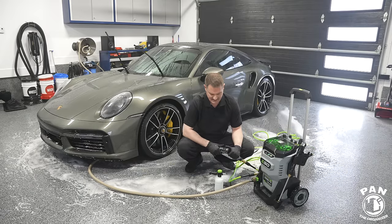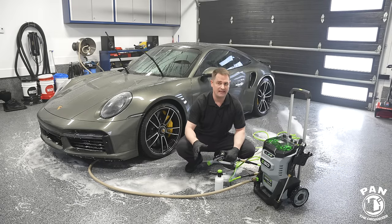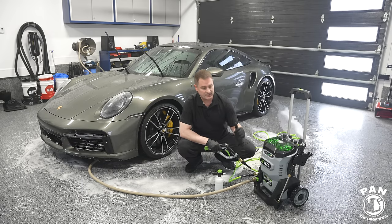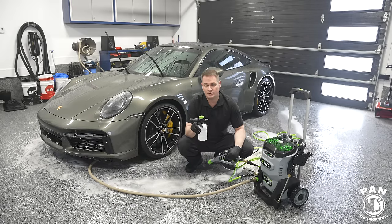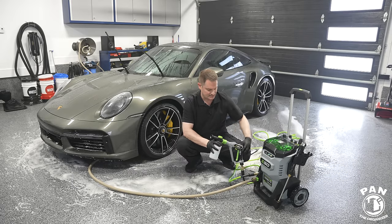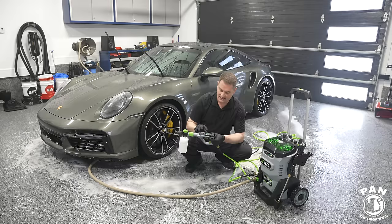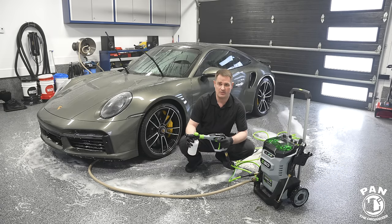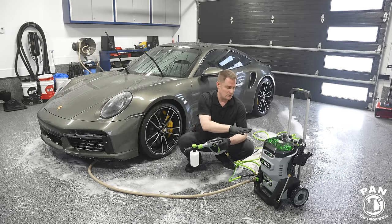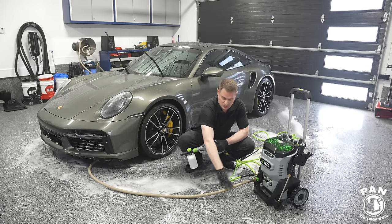Back for the second test portion with garden hose water supply — roughly 75 to 80 PSI input. Using the same soapy solution: 500 mils warm water with about an ounce of Phoenix EOD Apex Auto Wash. Connecting the foam cannon on turbo mode. Battery check shows only one bar down out of five, so definitely enough power for a full vehicle with the two 6 amp hour batteries.